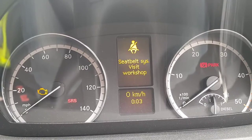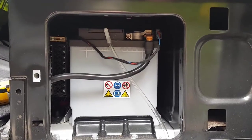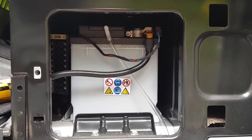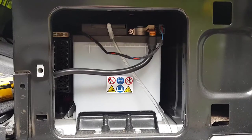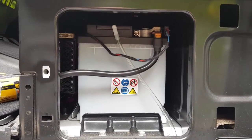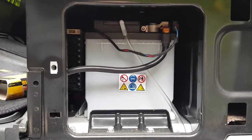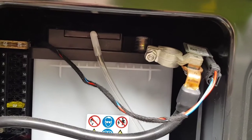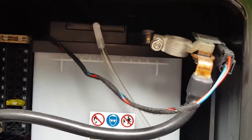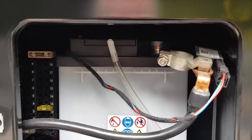The first thing to do is probably to disconnect the battery. I've switched the ignition off and moved around to the passenger side of the vehicle. I've popped off the cover under the passenger seat and here you can see the battery — that's the negative terminal on the top right going down to the grounding point. I'm going to disconnect that using a 10mm socket and an extension. That popped off very easily. I'm going to wait 10 minutes now for the airbags and other things to lose their charge, and whilst I'm doing that I'm going to have a quick cup of tea.